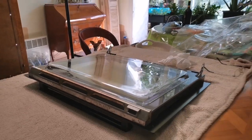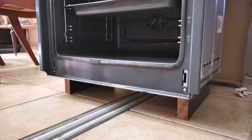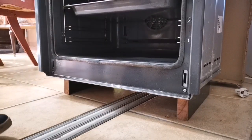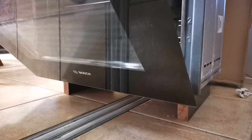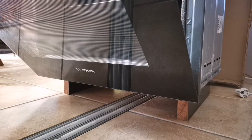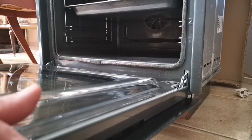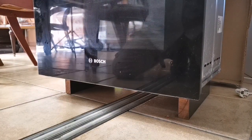And all that's left is to click it back on. These hinges have a little notch cut out of them, and that goes on each side of the door. It's quite heavy, and they both have to go in together. You have to clip those hinge locks back in place — snap shut. Replaced oven door.